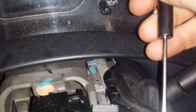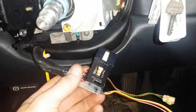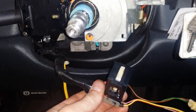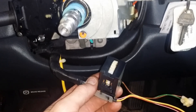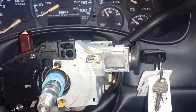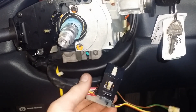You can also release your buzzer switch which is up here — just come in from the top. Once your ignition switch is out you can see the gears on it that mesh into the gears inside the case. You want to make sure everything gets indexed properly. Right now the ignition switch itself is in the off position, which is the position the key was in when I pulled the switch out. Make sure you don't rotate that, and make sure your ignition cylinder is in the correct position when you reinsert the switch.